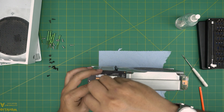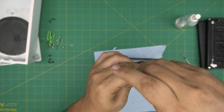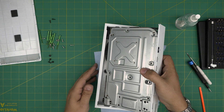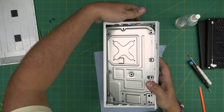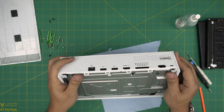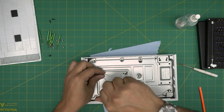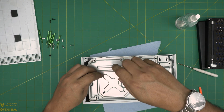Put the side panels on — place them in position and put the black screws back on. Once all side panel screws are in, grab the console, hold it at a 45-degree angle, bring it down into the front all the way inside. The side panel hinges may resist, so open them up and squish them aside so the cover drops in. Close it down and make sure the hinges are nicely aligned on the corners.